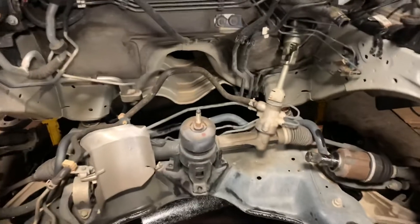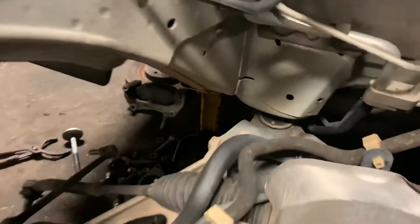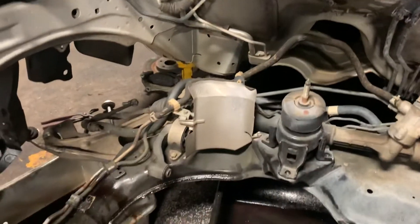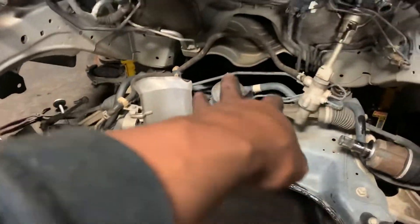As you can see, I didn't have to take the frame out. I took all four bolts loose — the ones in the back I left them loose, both of them right there. I took the rack and pinion loose, as you can see it moving right there, so that way there won't be too much tension on it. The frame bolts are in place. Of course you got to take the muffler and stuff. The tip here: you don't have to take the frame loose, so you don't mess with the alignment.